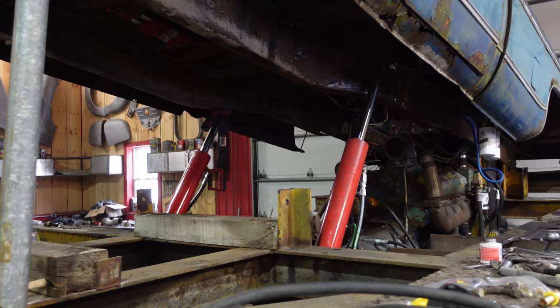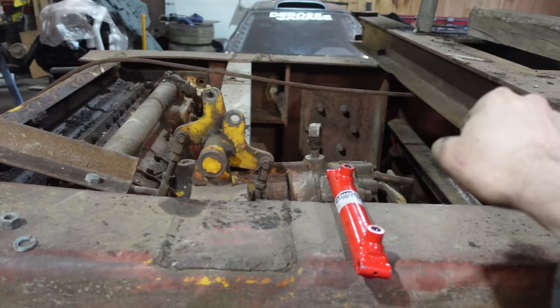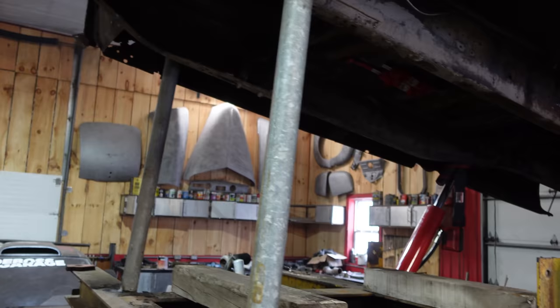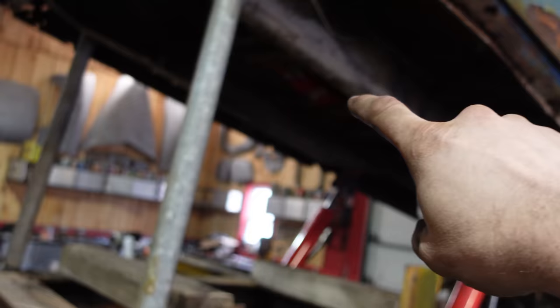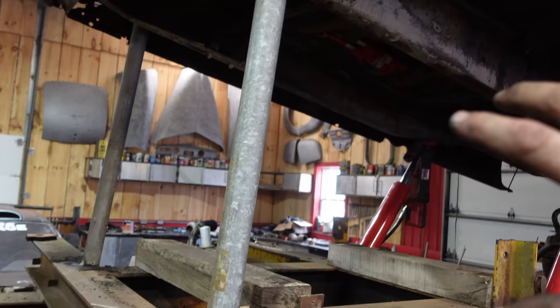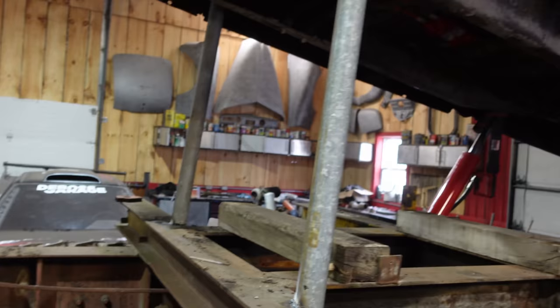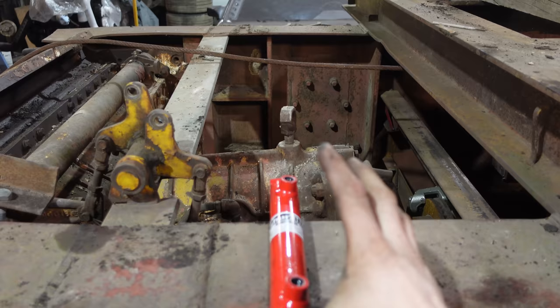But I'm going to get going on the shift cylinders, and I don't know exactly where to put them. I would like forward to be forward and backward to be backward, and I get it's a little confusing with the cylinders up in there and the lever action and stuff. So I think I know the length of the hoses roughly, and I'm going to make them so that they fit on the front. I can hide a little extra hose, no problem. And if it's way too long, I just cut the end off, put another fitting on it and crimp it, so it's not too expensive.